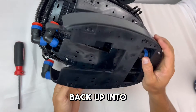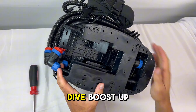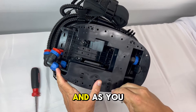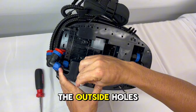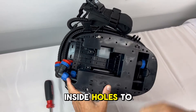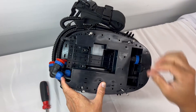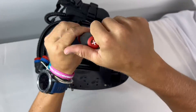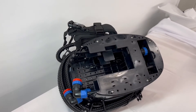As you work the cable back up into place, make sure all the cables are routed properly, then press the second Dive Boost up onto the first and line it up so all the screw holes are aligned. This time, choose the inside holes — if you used the outside holes, the screws would run into the screws of the first Dive Boost. Make sure to use those inside holes. Tighten down into place, make sure all the connectors are routed properly, and you'll be good to go.